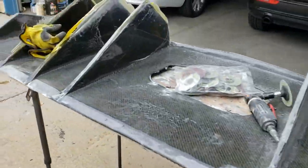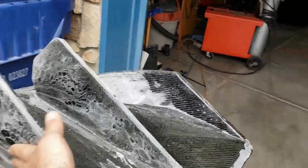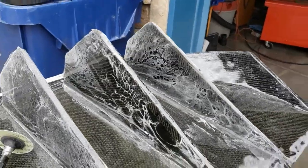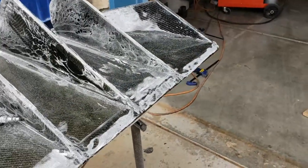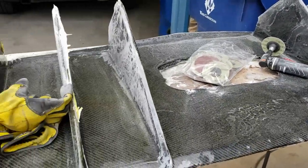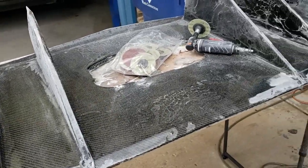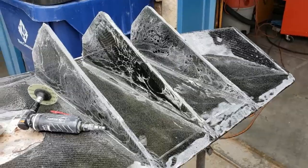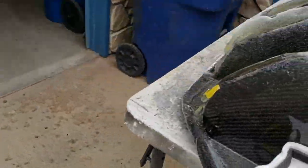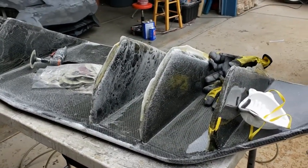The other thing we've been doing is sanding. We flattened out the fins so we got them nice and flat with epoxy. What you see on there is just some detritus that'll wipe right off, so those are looking pretty good. We're sanding down some of the more egregious drips and runs, and then there are some repairs I need to make where it kind of blew through the carbon fiber a little bit — but that's actually quite easy to do and I'll show you how those repairs go. This is getting close, so I think maybe by next update we should be able to clear this and get it back on the car.